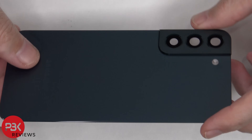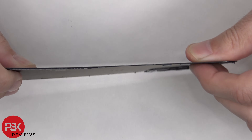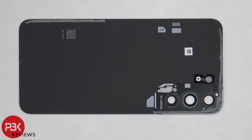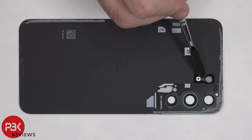Here's a better look at the glass back plate. The glass camera lens covers can be replaced by applying heat and prying them off. The aluminum frame or camera bezel can also be pried off, but it requires removing the back plate. On the back, we can see the aluminum frame, which is tucked underneath and adhered to the back glass. On the flash diffuser, there's a hole for the back microphone, and there's a small pathway inside which picks up sound from the ring of the flash diffuser.